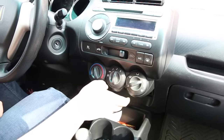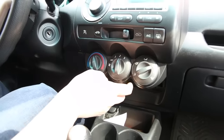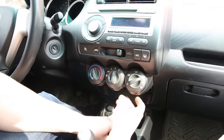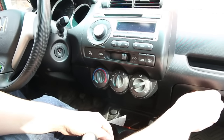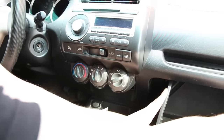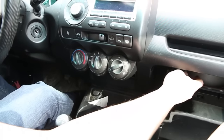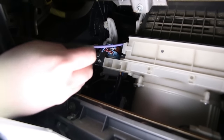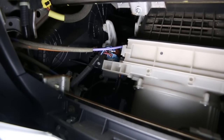Once you do that, there are two bolts underneath here that you have to remove, but before that we have to disconnect three cables that are holding the radio panel. Without removing them you can't remove the radio. So we have to drop the glove box down — basically push on the ends and the glove box drops. As you can see there are three different colored cables: purple, orange, and blue — those are the ones we have to disconnect.